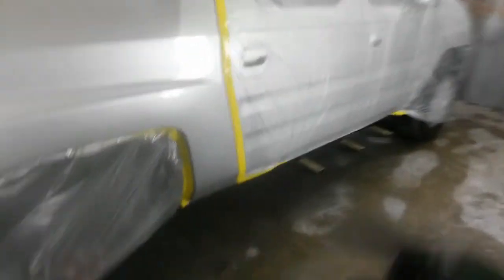Got the 1000-grit all through here. Down here I've got to do this by hand where they've got this transition, and I'm going to try to cover that with the pinstripe. The whole panel and the door - they taped it along the door, painted just from here up, and did the hail damage job. I'm going to scrub this real good with a gray pad and some scuff paste to get down in there. I'll make sure I get plenty of adhesion promoter in there. This is guide coat in here and we'll rub that off. I'm going to cover all this with silver, blend down onto here, and clear this entire panel all the way to the bottom.